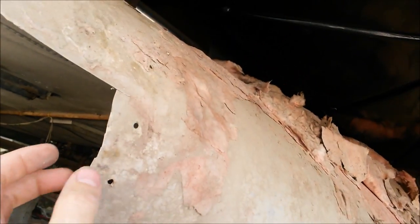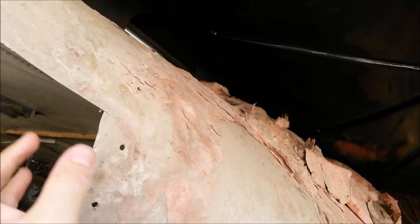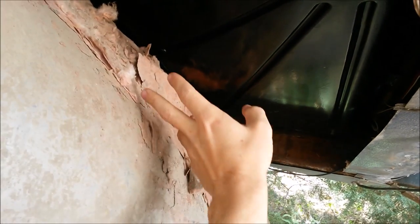So first thing, of course, you need to drop your underlayment. The newer ones have a plastic corrugated material. Older ones have an aluminum sheathing under there. It's a good opportunity to replace all the fiberglass too. So drop your underbelly, get to where you can see the tank and where you can get to the attachment points. I've got three on each side.